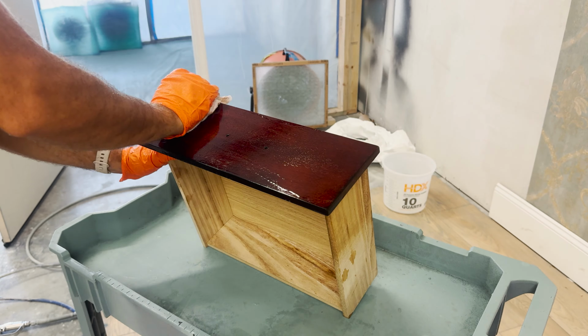So what I'll do is take this 2000 or 2500 grit and wet sand it, just keeping a spray bottle of water to mist it. This is a 2000 or 2500 grit cushion sanding disc, and it's a 6-inch, but I only have a 5-inch sander, so I just use what I have. I'll just keep grinding on it. The surface should look dull after you're done, but flat.